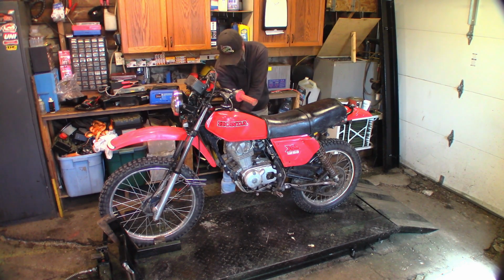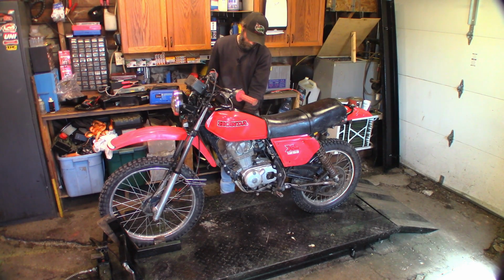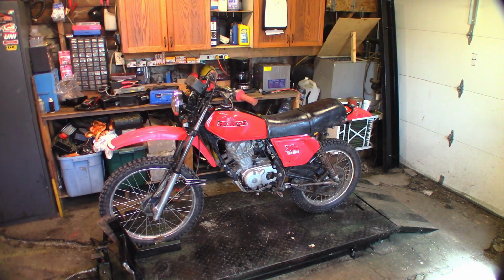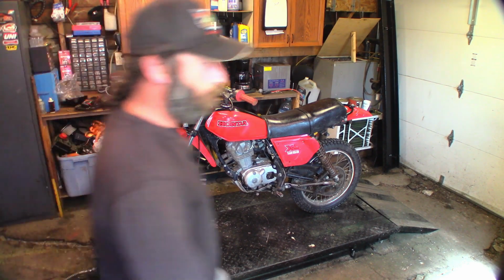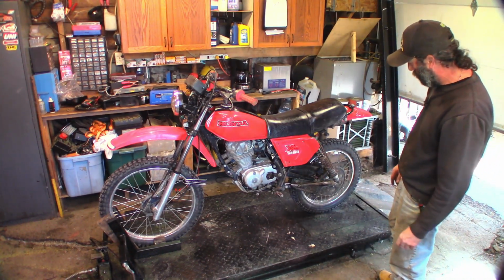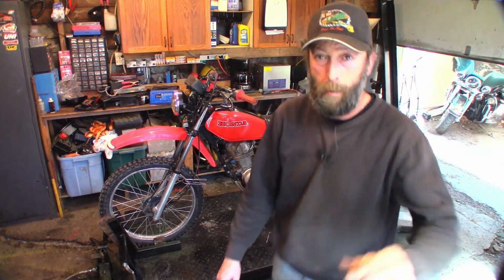That's actually low. It's supposed to be a little more than that. High. I don't want 1400. 1200. 1200. Sounds good, actually. It's nice. Oh, God, let's get the door open. Doesn't run as rich as it was. I think the pilot screw was out 3.5 turns, so I'm gonna take it for a little ride in the backyard. I'll be back in a second.